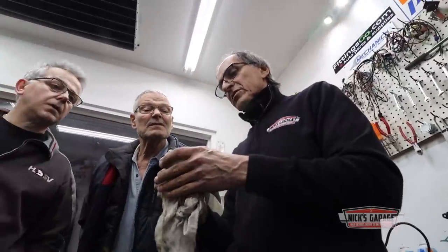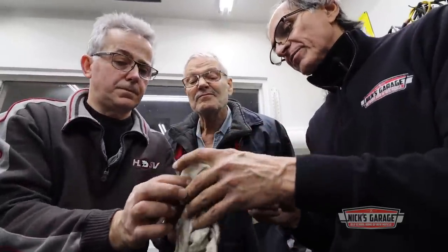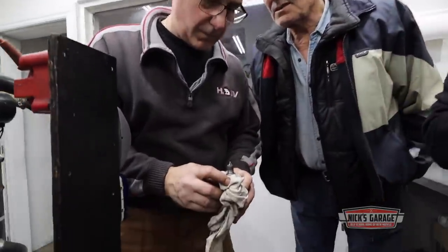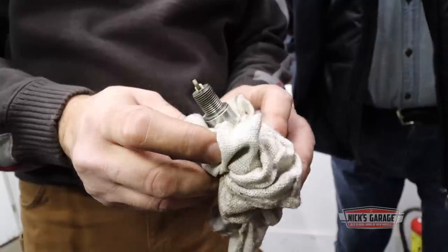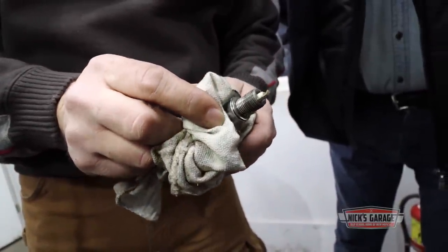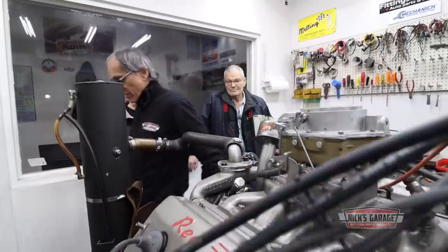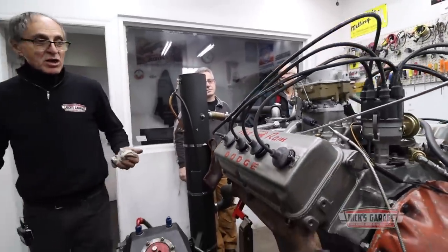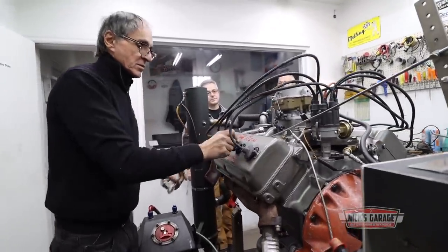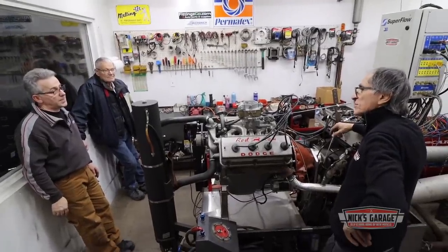Jeez, it's hot, it's hot. It's not that bad, eh? Clean, very good. But look, I think it's running lean, eh? You see no black at all, but then you gotta look deep inside. Look at that. Yeah, deep inside. No, it's running lean. You should have some black on the outside also. No, I'm not worried. But then again, this is all factory. That's right. We have all factory jetting, nothing's blocked, it's all there. I got no exhaust leaks, the timing is where it is.